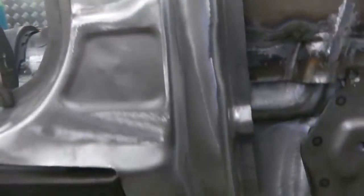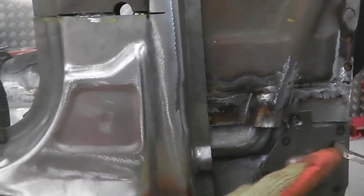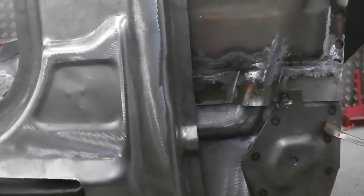Down this side, just to trim a bit more till that starts to fit snugly in, and then we are ready. Here the inner sill fits with a repair piece we made. Once pulling out a touch, that tab goes over the side. That's just the way it is. You always have a little bit of a clearance under there. They're never snugly in.